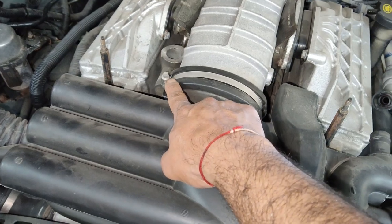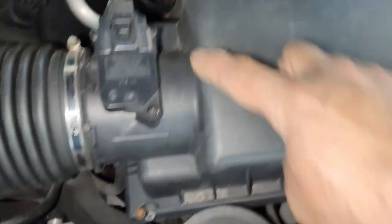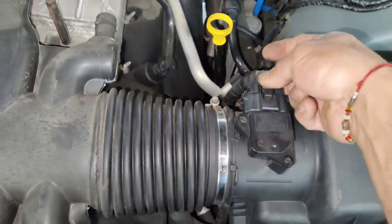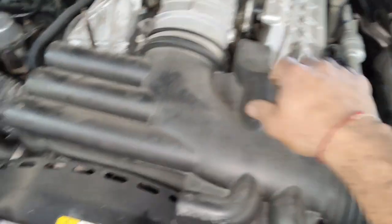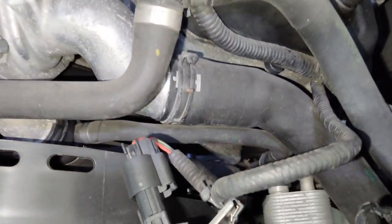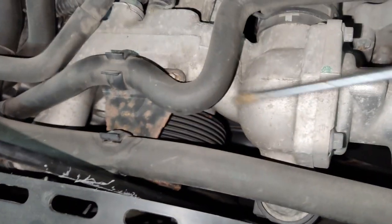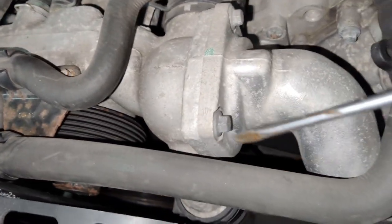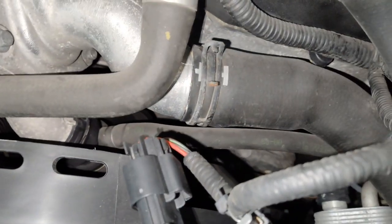We'll also be removing the intake tube along with the air cleaner. There's a clamp here and a clamp here — you can separate it there or undo all the Phillips screws on the air filter box. There is an electrical connector that you squeeze and pull out, and a hose that also needs to be disconnected the same way. Now that the intake tube is off, that gives us access to the belt tensioner. This truck being supercharged actually has two belts — the supercharged belt is ribbed on both sides, and there's a secondary belt behind it that drives the alternator.